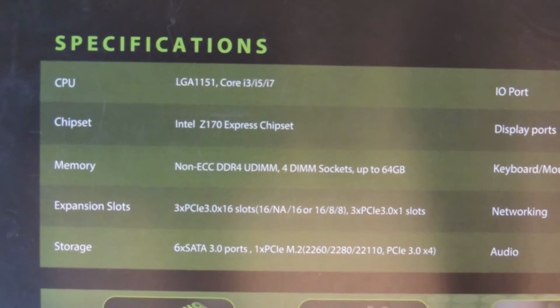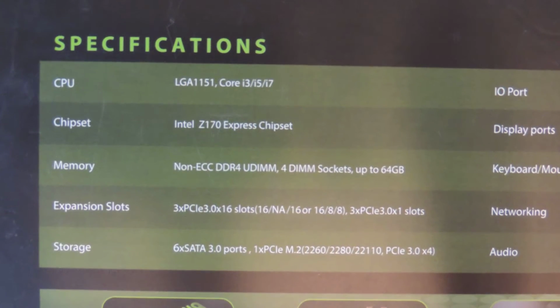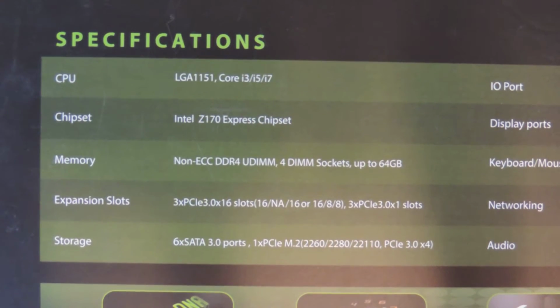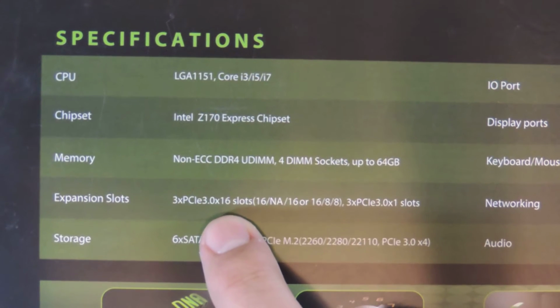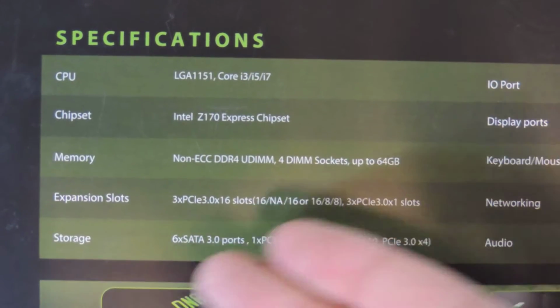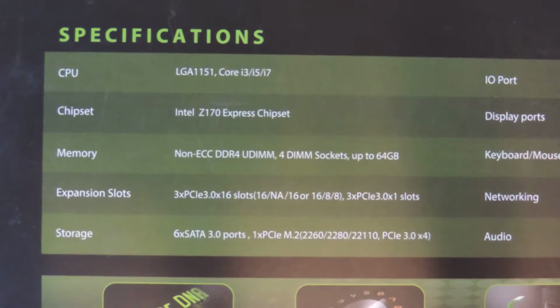It supports 3-way SLI, which is much more likely to occur than 4-way SLI on the Z170 platform, pretty much because you want a much better CPU if you're going to go that high in terms of gaming performance. Now, this is only a 3-way SLI board, while some motherboards with the PLX 8747 can do 4-way, but I guess Supermicro decided to go for this for spacing constraints. I'll talk about later the benefits of going with 3-way.